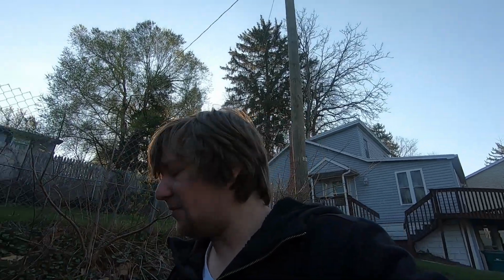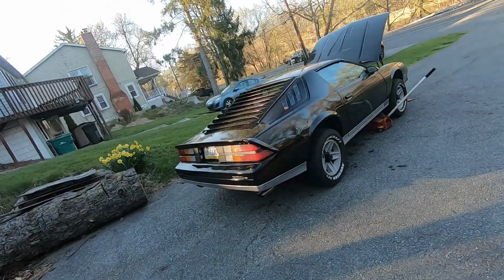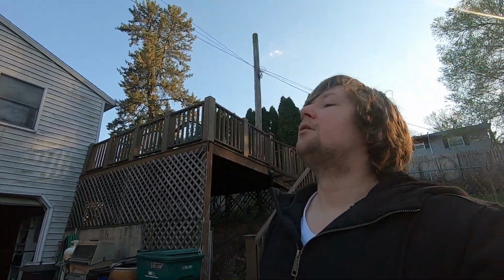They got the car with, I want to say, more than a quarter tank of gas, between a quarter and a half a tank. When I got the car back, it was on E, and I made it less than a mile from their shop, and it ran out of gas. So I know exactly how it feels in this car in particular when it runs out of gas. That's what I was feeling when I got stuck on the side of the road. And when I pulled the air filter and I was looking at the carb when I bumped the gas pedal, I could hear fuel spritzing.